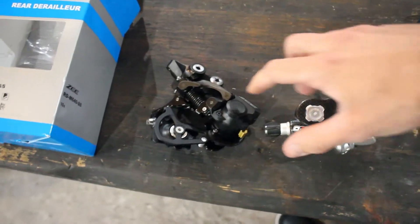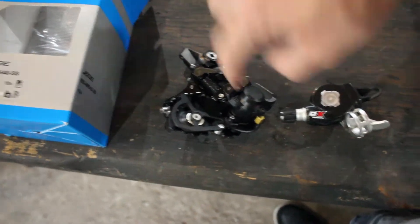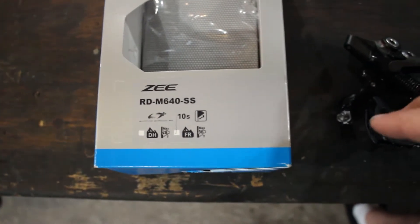To do this, the cable pull on this is perfect. It matches up - not for 10-speed obviously, but for 9-speed, and then it works. Because SRAM and Shimano shifters and derailleurs aren't supposed to be able to be used together.